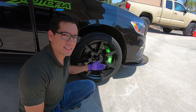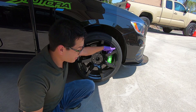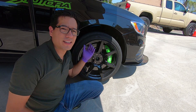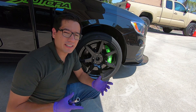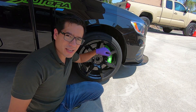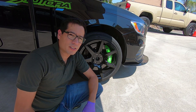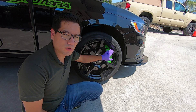As you can see behind the Project 6GR wheels, it is a perfect fit in the front. I can fit a pinky between the brake caliper and the wheel. Now the front brakes, if you remember on the last video, are going to be a little bit thicker — 20% thicker pads — so the caliper is going to be a little bit thicker. We'll see how this space turns out. I also need to run a 3mm spacer for the rear wheel to clear the Rotora caliper.